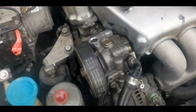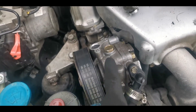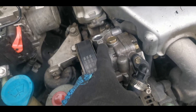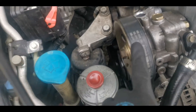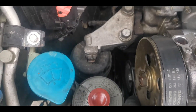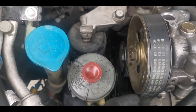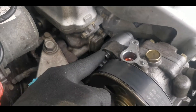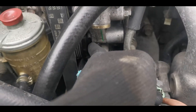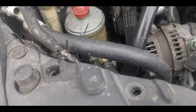Based on what I remember, to remove the power steering pump you'd have to remove the lines — two lines, one already came off. You have to remove the belt, and you ease off the belt by pushing some pressure on the tensioner pulley, which is right here. Then you take the belt off, and then you're gonna have to unhook this screw and this screw right here — two screws hold it up.